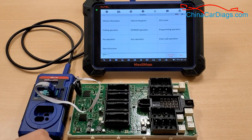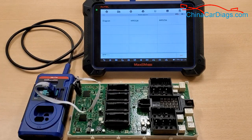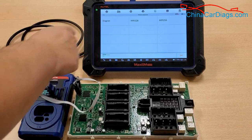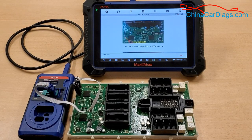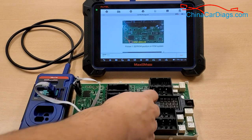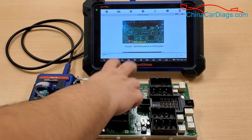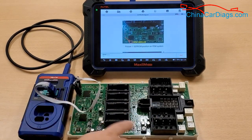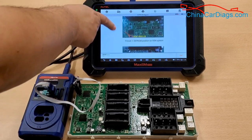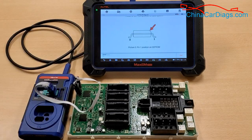The next step here is select the EEPROM operation. And then before you go anywhere else, select your diagram. Now we provided you a diagram on this particular FEM module. Just make sure that you remove all the fuses that come with it, as well as the cover for the top — you don't want to break any clips. On this board right here we have the M95128. Yours may be a little bit different, so please keep that in mind. If you go a little bit further down, this is the diagram that you can use for the chip.